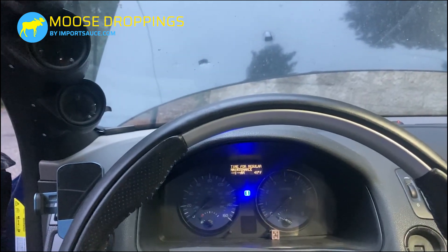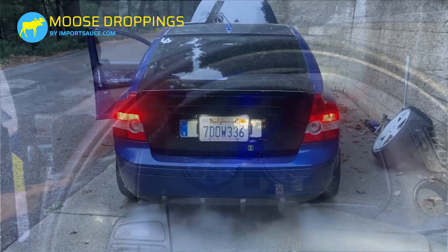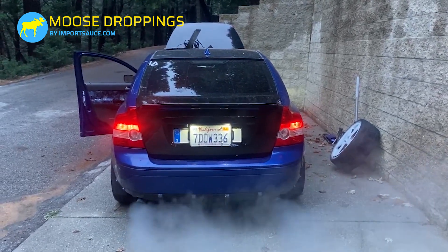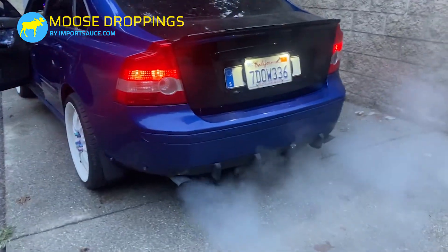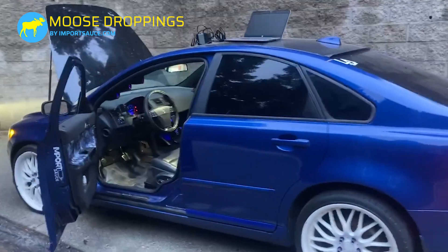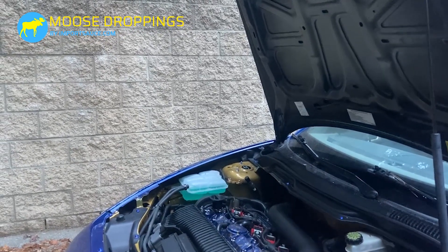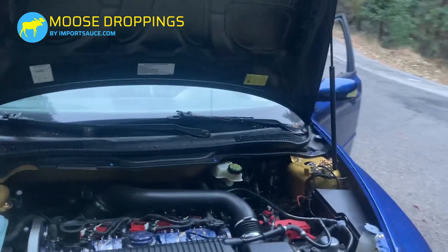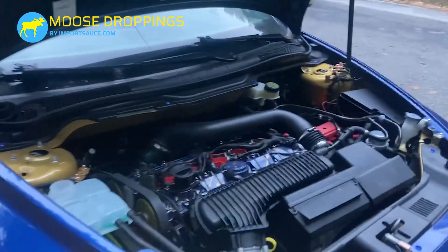I can smell some break-in oil. I'm going to go out there and put in the last quart of oil, then we're going to let it run, data log, and send that back to Hilton. This thing is fired up and idling. Topped off the oil — we're up to seven quarts. Oil pressure looks good. Probably got some break-in lube and assembly lube burning off. I'm going to start the data log and keep an eye on it. I topped off the water when I topped off the oil and it looks like it's mixed and circulating. Got a check engine light — I'm going to see what that is. I figured there would be at least one. Everything's running. Nothing blew up, so that's something.